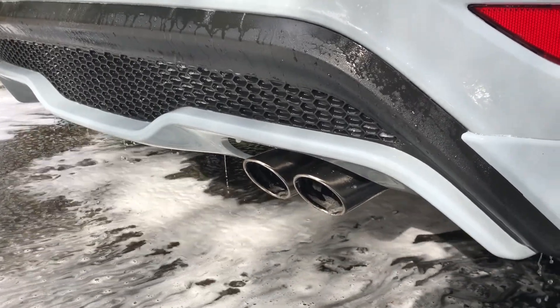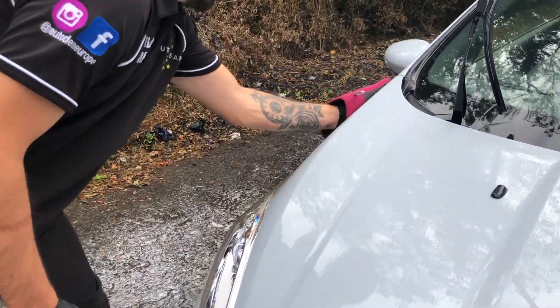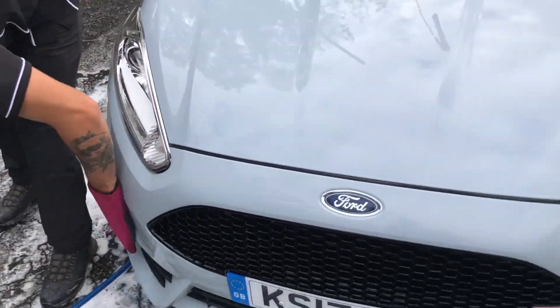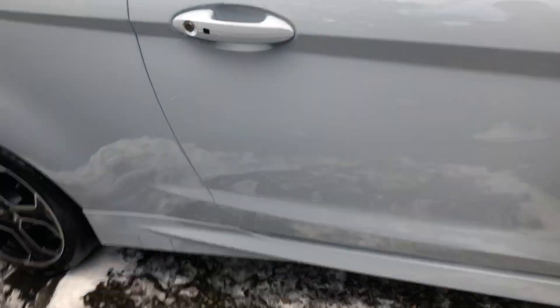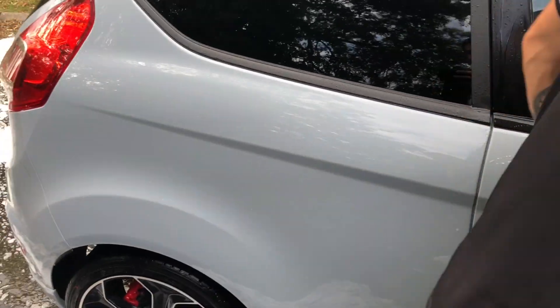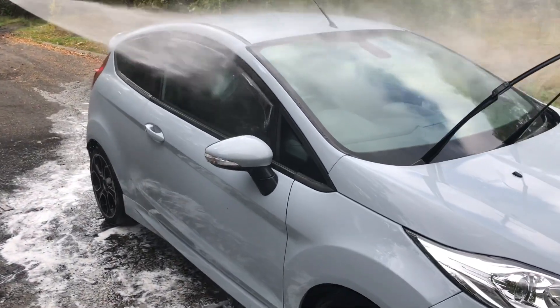Because it was filthy and black last time, I haven't seen it looking nice and shiny in ages - that looks good. Clay bar helps get your tar and any other stuff off the paint. Basically it gets all the stuff the power washer and the brush can't get off, like tar that may come off the road and glue to your car. There is a spot of tar just here - that little black bit - and you can't get it off, but apparently this magical glove can. Oh look, it's gone - it has disappeared. The magical glove!